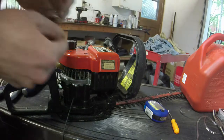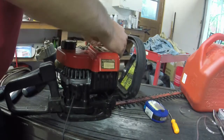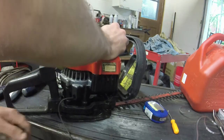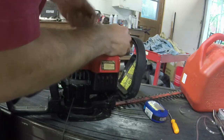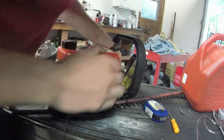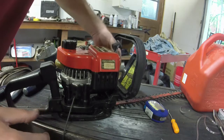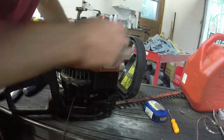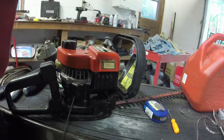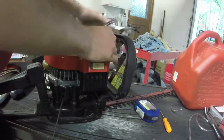I had to do a little bit of finicking with the 19-inch one to see if it would work or not. Let's see what we got here. Oh gosh, that spark is super strong. That's awesome. Put the plug back in. We still got a fuel delivery issue somewhere. I think I might just have to adjust the jets and such, or the low and the high speed. Wow, I'm thinking of push mower stuff. Ride mower stuff. I think I just gotta adjust the low speed and the high speed some. I think we're gonna be alright.